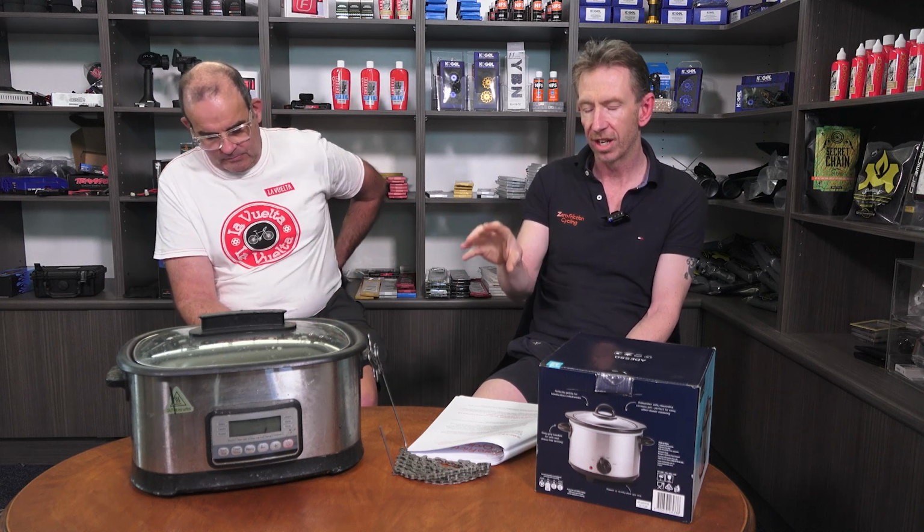The first thing I'd say is if you can, use the immersive wax as your number one option over the top chain coating wax lubes like your UFO Drip, Silca Super Secret drip, and Tru-Tension Tungsten All-Weather. They are brilliant lubricants, and in a single event come close in a lot of cases to matching, or UFO Drip claims to be faster than, Molten Speed Wax and Silca. But for a really long event, with anything out of a bottle, at least half of the volume is going to be carrier.